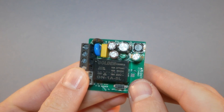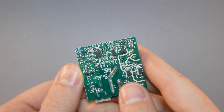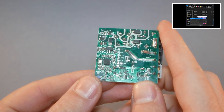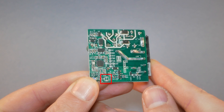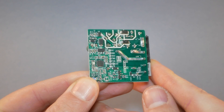You probably want to know what's inside. The device is rated for 10 amps, however inside you'll find a relay rated for 16 amps — something tells me the 10-amp rating is just to account for inductive current. Looking at the other side of the PCB, there are a couple of interesting things. First, we have an EFR32MG21 Gecko module — a very familiar chip also present on the Sonoff Zigbee bridge. The advantage is that it uses Zigbee 3.0 and can act as a router, expanding your mesh network. There is no external antenna, but on the PCB there is a space for an SMD connector, so if you want to increase range or place the antenna outside an interference area, you can solder SMD components to connect one.